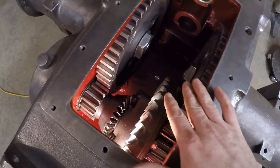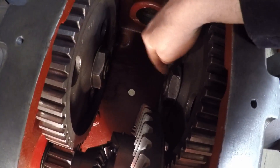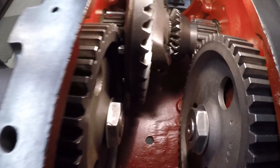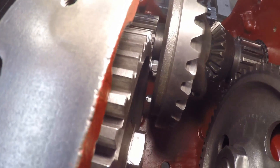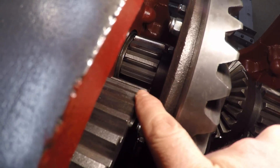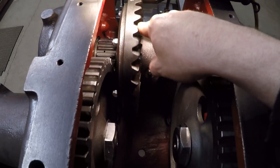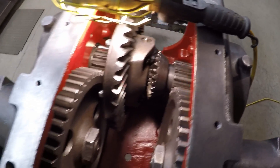It was a whole lot of taking apart and putting back together and trial and error, but it did come together pretty well. It's kind of amazing — of all the parts in the rear end right now, there are only three original pieces that were in here before: this axle and both bull gear nuts. Everything else has been completely replaced with production parts. At the end of the day, all that work was worth it. You can see now why good spline fit between axles and gears is so critical because of the very limited space between some of these components. Everything is fitting just like it should — the bull gears are meshing perfectly in line with the bull pinions, and this whole thing is smooth and whisper quiet. This poor tractor has not had a rear end in this good of shape easily for decades.